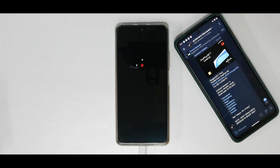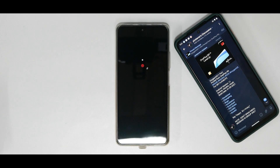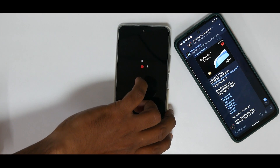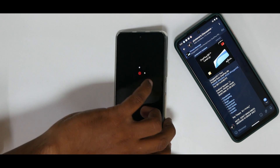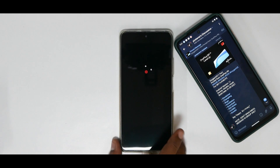Some people have encountered a boot loop — this is the second time I'm flashing today and it's booting fine. But if that happens to you, go to fastboot, flash TWRP, do a Format Data, reboot, and you should be fine. Once it's booted, disconnect from the computer and reconnect the OTG cable because we need to flash Magisk and root the device to flash the fix that allows wired earphones to work.